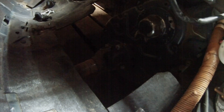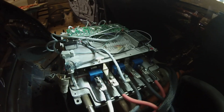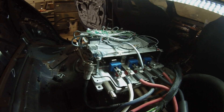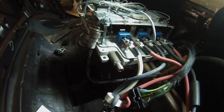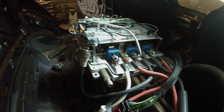For those of you that maybe haven't followed the series, down here we've got a direct drive setup with a crazy gearbox and short drive shaft. What I've got to do is cut some of the wires out of this connector, connect them in here so we can get 12-volt and throttle pedal going, and then we can see if we can pre-charge this thing and get it to move. Less conversation, little more action.